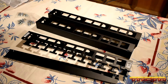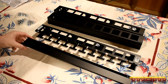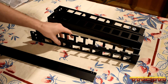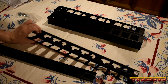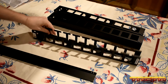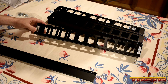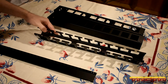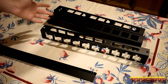You have this front face plate that goes on the front, and then you have the cable management bar - just these little fingers. You route cables between them, that's really all there is to it. This will be the top because you want to hide the barcodes. The model is CM Duct 1UX. These mount with holes out the back as well, so if you want to route them out the back - which is what I'm going to do - it's nice and clean.